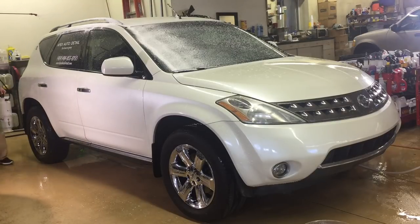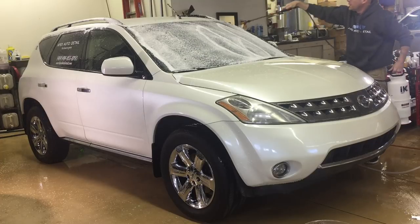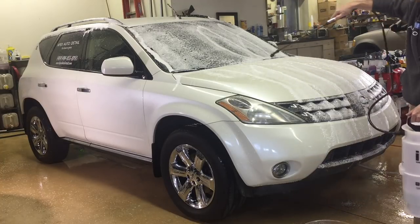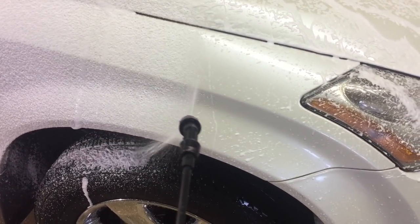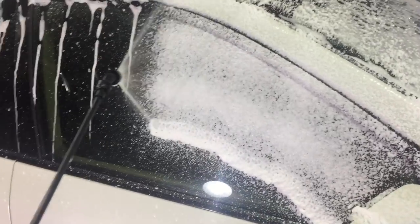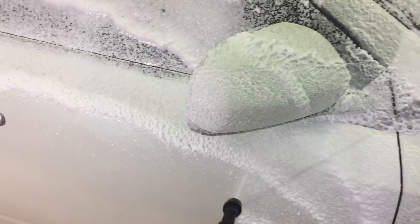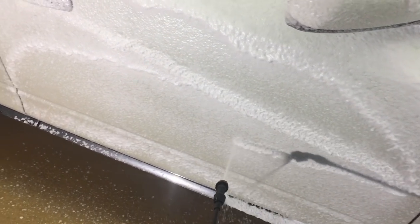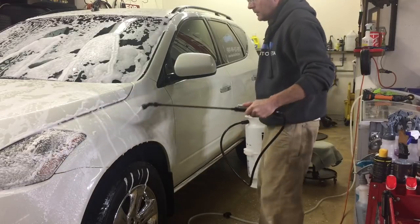As I mentioned, this is going to be a full wash routine, so next we're going to foam it. Angel Wax Angel Wash — I have one ounce in one of these IK foamers. You can purchase the larger one or they have smaller pump sprayers. You can foam the whole vehicle if you're in a shaded area or it's overcast and not breezy, or you could pull it underneath a pavilion. If not, just foam a section at a time — a roof, then the window, then the hood, a section at a time, then rinse and move on. I'm sheltered here so I'm going to foam the whole car and then rinse it, then wash the whole car and rinse it. The IK foamer can handle foaming the whole vehicle very easily and quickly. By the time you get all the way around the car, the foam has dwelled for six, seven, eight minutes — perfect timing to grab the HydraShot and give it a good thorough rinse.